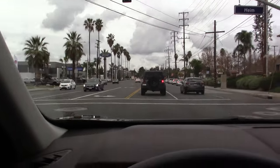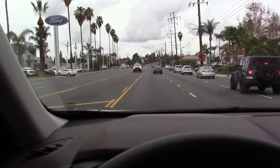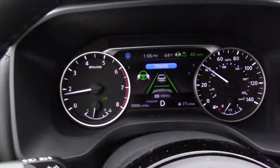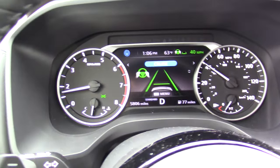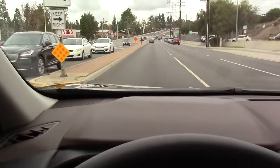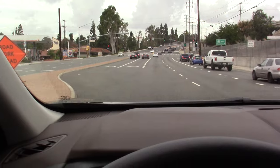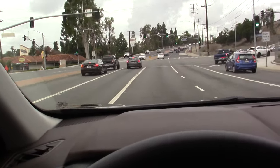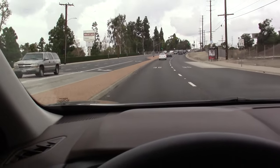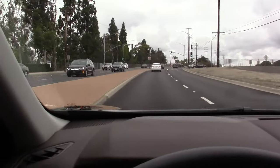All the random beeping you've been hearing throughout this video is the steering assist turning itself on and off. On surface streets it's much less consistent, because when you go through an intersection there are no lane lines — right there it just beeped that it turned itself back on; I know it's on because it's green and shows me the green steering wheel with hands on it. But when I go through an intersection it might lose the lane line, and then it'll turn itself off automatically because it works by reading the lane lines. If the camera can't see the lane lines, it doesn't know how to keep you centered in your lane, so it turns the steering assist off automatically.